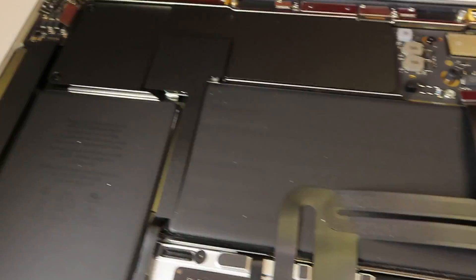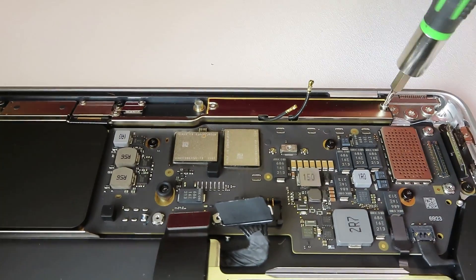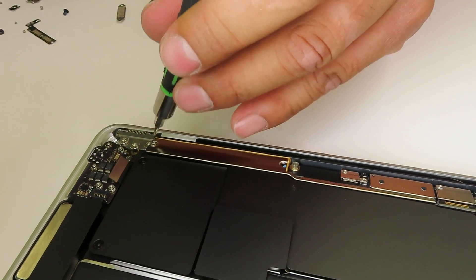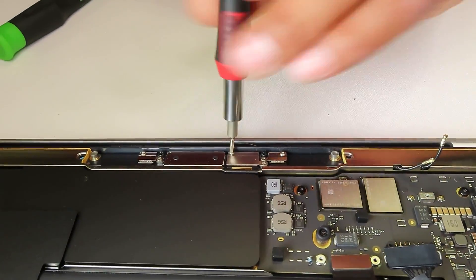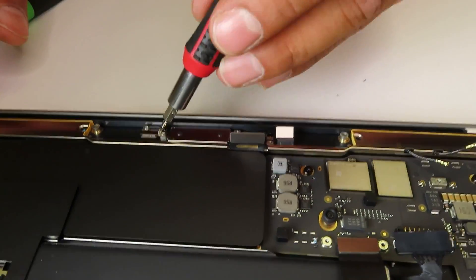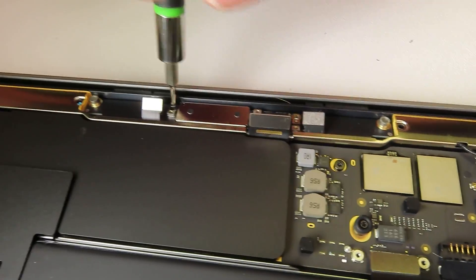On the left side there was an audio port, and here I'm removing the Wi-Fi antennas. There's actually a fairly large Wi-Fi antenna here. It was a bit complicated to pull — I'm going to remove it once I pull the actual logic board. There are three connections here for the LCD screen. If you need to replace the LCD screen, those are the connection plates you need to disassemble and disconnect the cables from in order to pull the assembly. Here it is — it's quite large and has two ribbons attached.